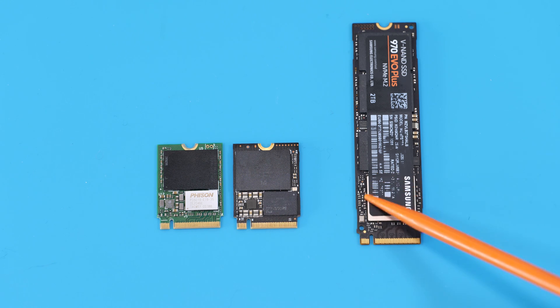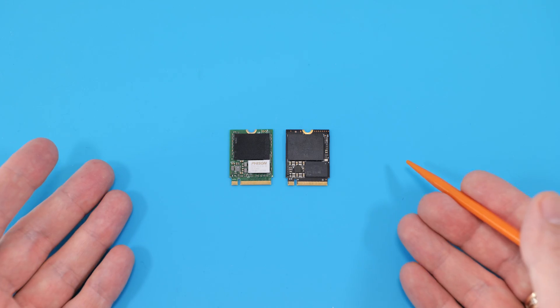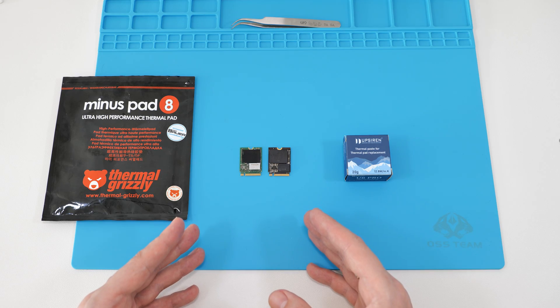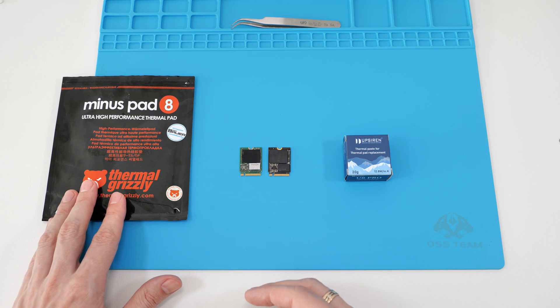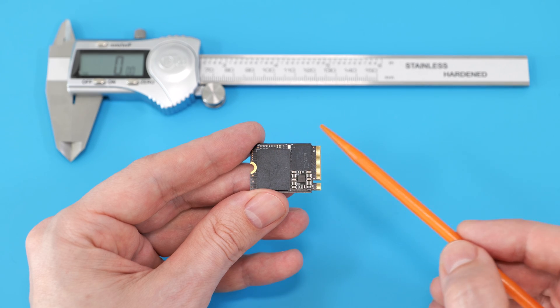For example, this controller has a much larger surface area, so it transfers significantly more heat at the same time than this one. But there's not much we can do about that — you can only help transfer that heat faster by using high-performance thermal pads or thermal putty.